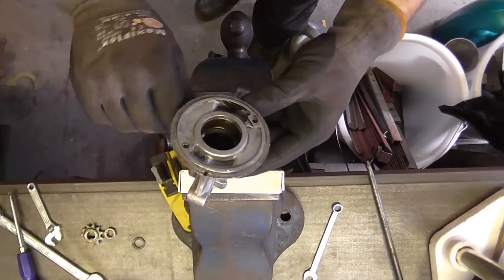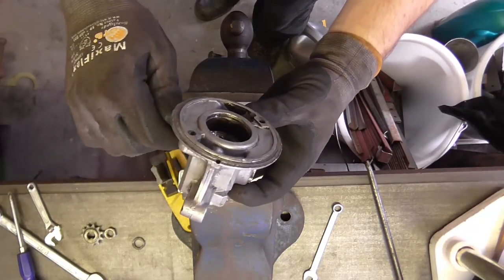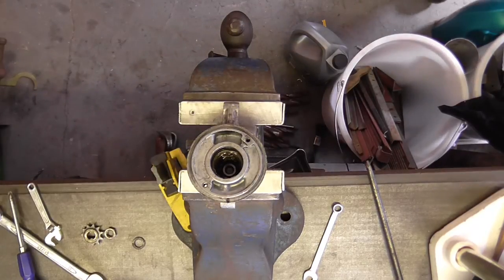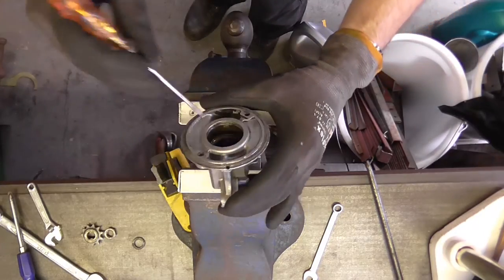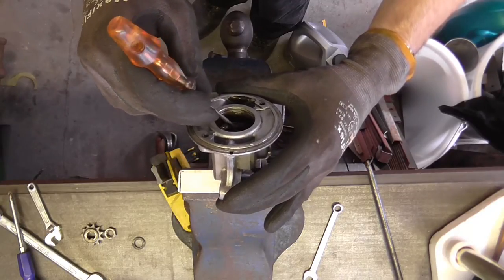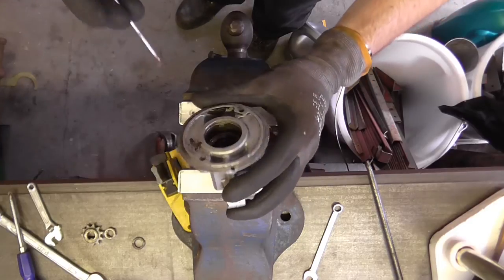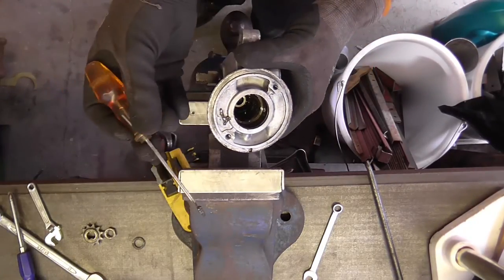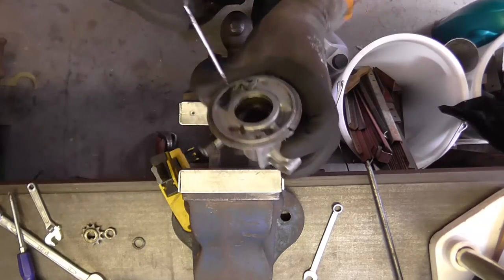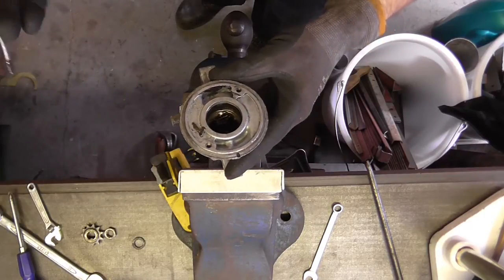That still doesn't want to turn. I can actually see a piece of broken-off tooth in there. So let's pull that out just for inspection purposes. Didn't realise about the oil, otherwise I would have had that out of there. That is a piece of the worm. This has in fact just been packed with grease rather than oil. It may be that because grease tends to get pushed out of the way and not flow...